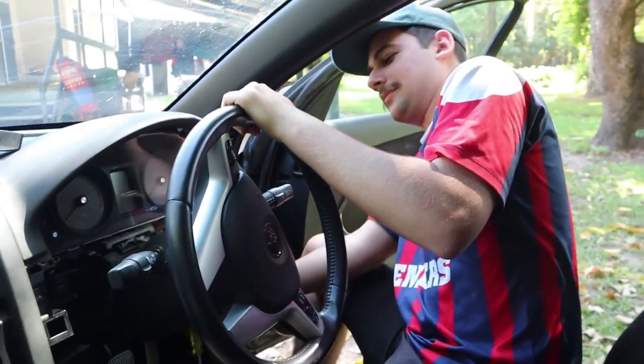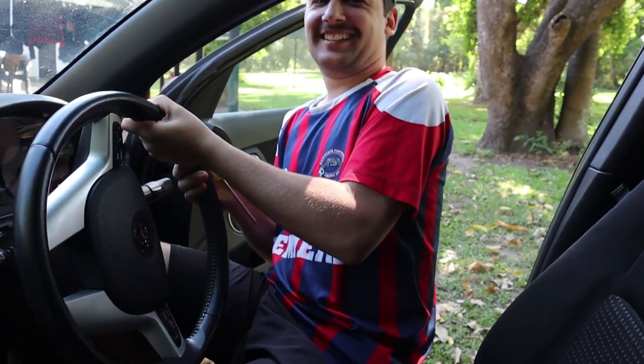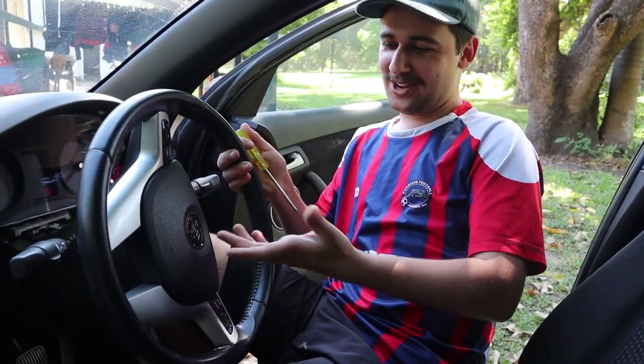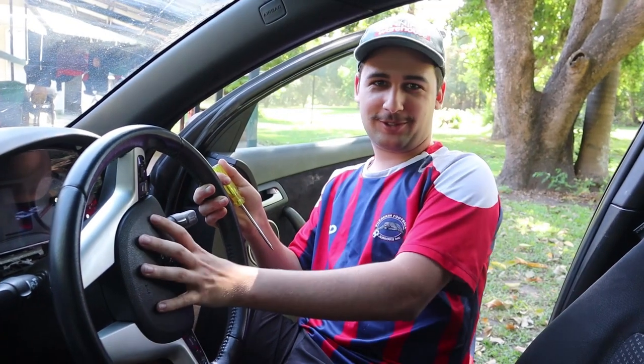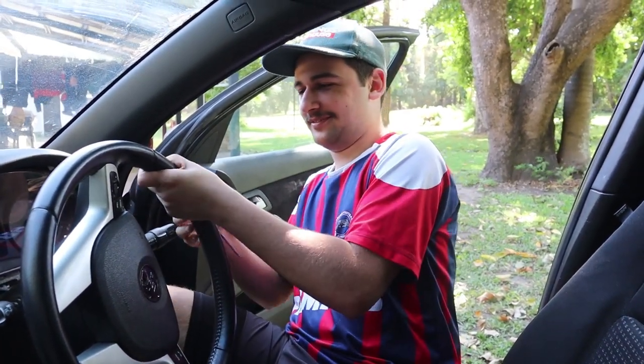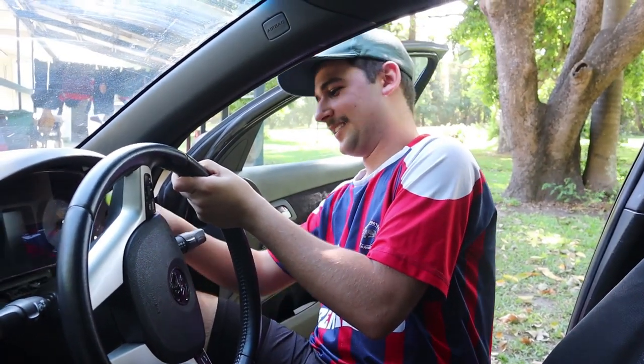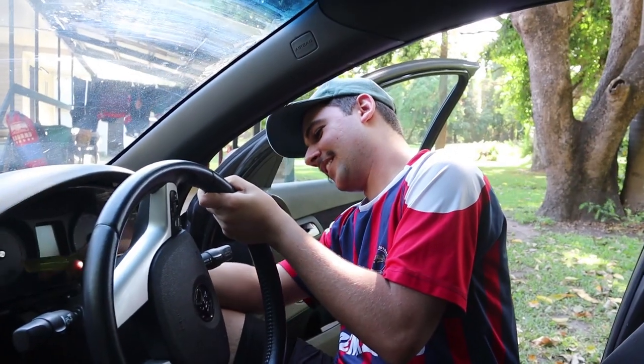While Dante's doing this little safety precaution, we figured out to just sit on the very edge of the seat. This is because you've got an airbag and you obviously don't want it to go boom in your face. It doesn't have electricity — we've taken off the battery — so theoretically it should never ever go off. But we don't want to take the risk.